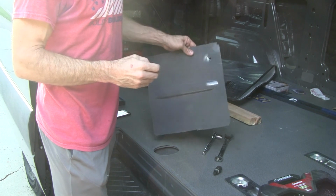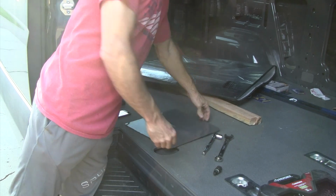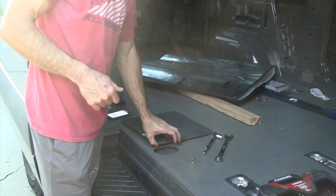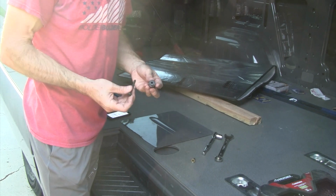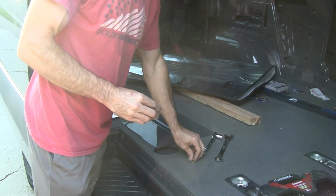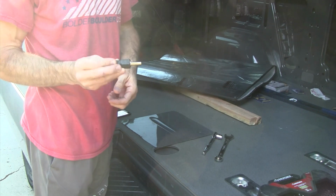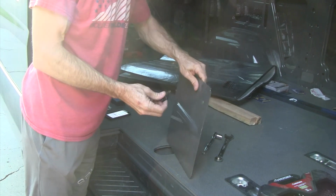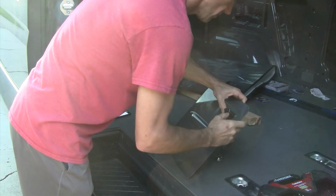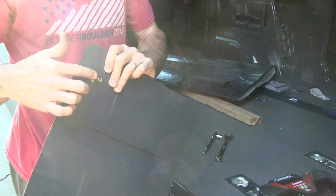And so I drilled a 3/8 inch hole in the metal here. And I'm going to use this hand-driven rivet tool to expand the cross nut once it's in there. So the instructions for the rivet tool say to take this threaded bolt, put it through here, then thread the cross nut onto the back like that. We're going to insert it into the hole. So you can see it's sticking out the back.